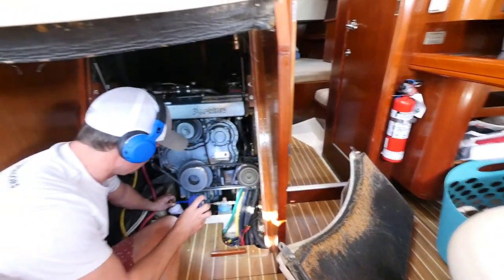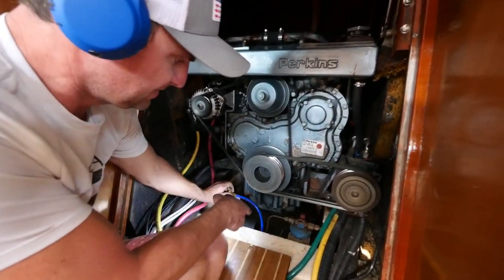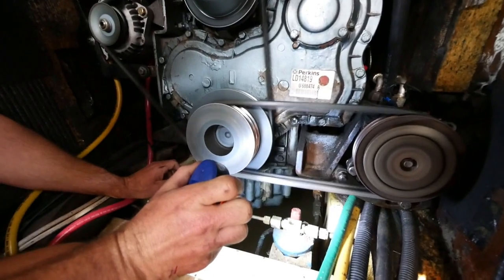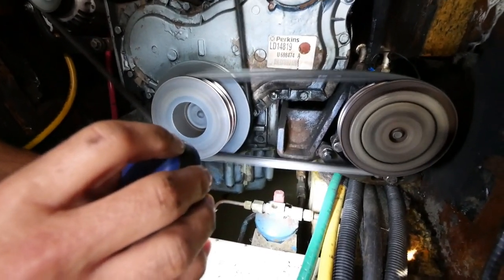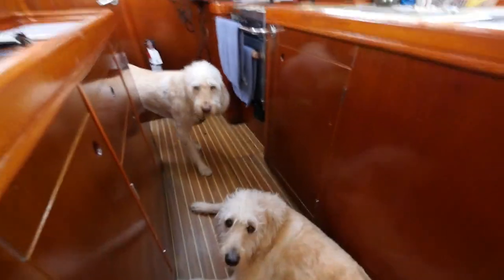This is just a standard automotive kit you can buy at any AutoZone or O'Reilly. The key is to pierce the canister and have the refrigerant running through the line before making the connection — that way you purge the line of air. Here I'm watching the sight glass to see the refrigerant as it enters; it's bubbling and foaming. What you want is for that bubbling and foaming to eventually go away and run almost clear with just a couple of bubbles.